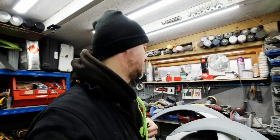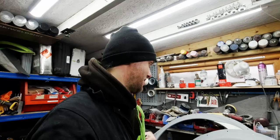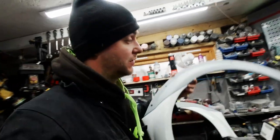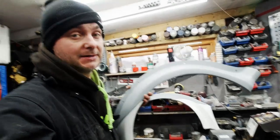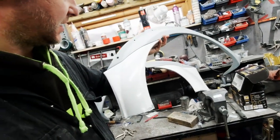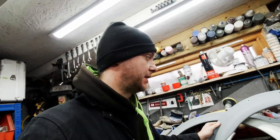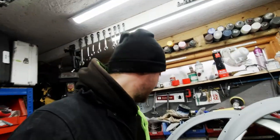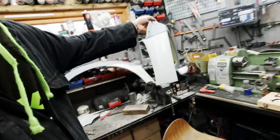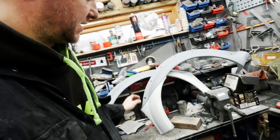As I mentioned in a previous video, we're not going to leave just the bumper by itself with the rear wheel open, because I don't think it's within the regulations. It has to be — I found varying figures, somewhere 100mm above the centerline, somewhere 200mm above the centerline. So we're going to remake the rear arches completely in kevlar for two reasons: one, because it looks bloody cool, and two, I'm going to use the original rear extensions that are supposed to go onto the bumper as supplied by MC Racing. I had to trim them because they were too long, and we cut the inside out.